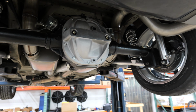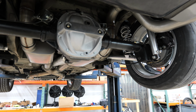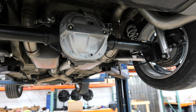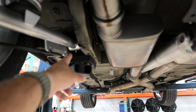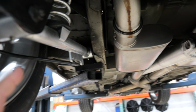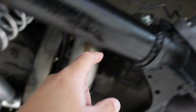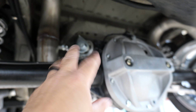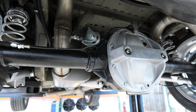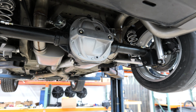Yeah, this rear suspension package, it's pretty much dead on what I did in that YouTube video with my recommended recipe for a street driven Fox body. I mean, by having the polyurethane bushings here and here, but then also putting the spherical here so that you get rid of the bind. Like, you know, this is a great streetable setup that you can still drag race.